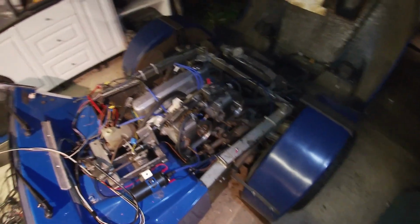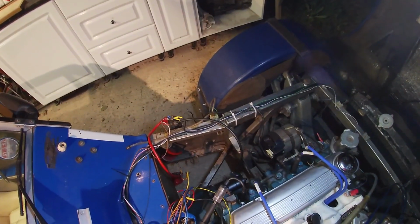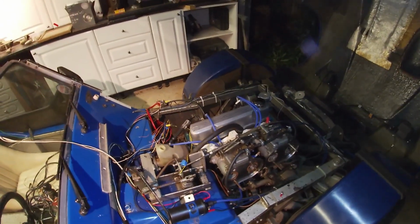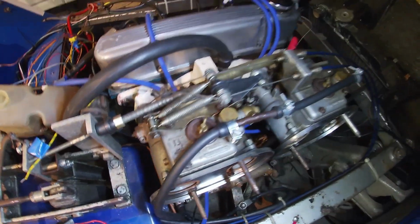It's quite nicely laid out, really. It's all box chassis. It's not tubular chassis or anything, but it is what it is. It's a sort of hand-built kit car, which is pretty cool. I believe that's Vauxhall Viva front cross member with wishbones and everything like that. So this is the 1600 crossflow engine, genuine proper Italian Webers 40s.